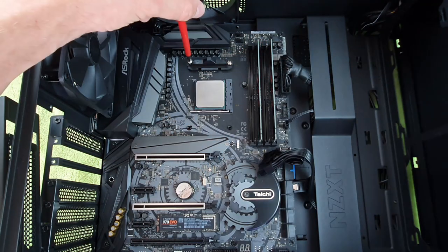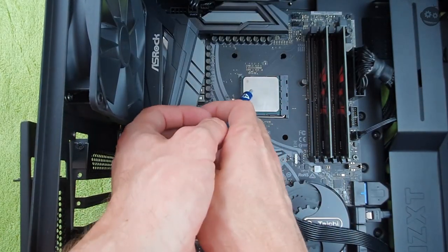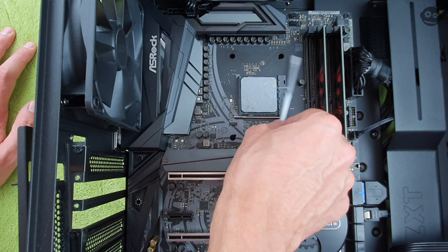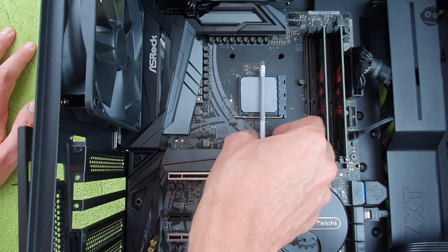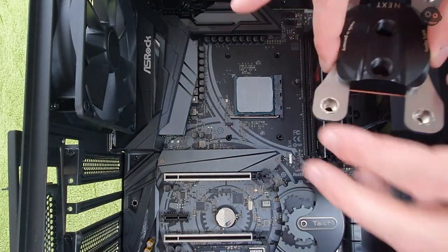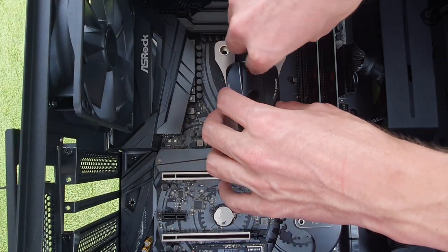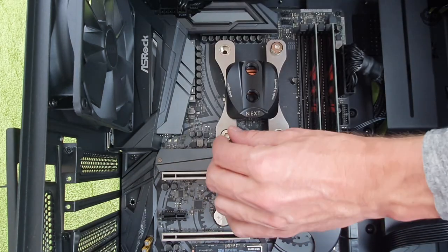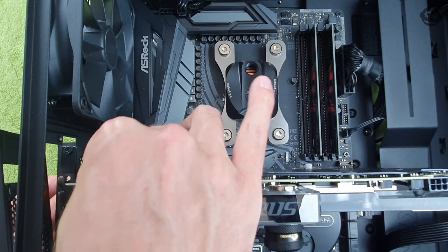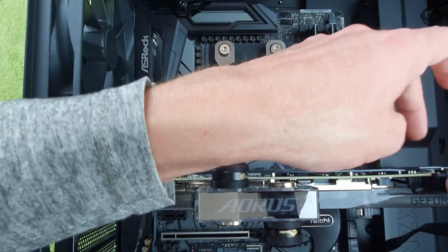Then we remove the old brackets of the CPU cooler — we won't need them anymore, but be careful, the back plate is still needed later. We applied some thermal paste; nothing special — I always use a straw to apply it evenly on the CPU. I prefer using a little bit too much thermal paste rather than too little, just to be on the safe side. CPU is in place and now we can screw in the cooler. The bottom one is the inlet as written in the manual, so you want the water to go in there. Put the screws in place through the back plate and in a cross pattern, screw it to the back plate. We put the graphics card back in place to check if everything works and confirm we still get a POST with the new cooler. You can run the system like this for some seconds as the coolers have a high thermal mass and you won't damage anything.